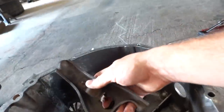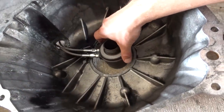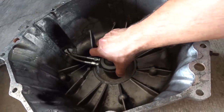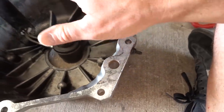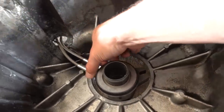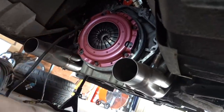In our old style we had the slave cylinder pushing on this, which would pull our pressure plate back. This is the new setup we're going with — basically a new slave cylinder, it's going to be a push type, it will push our pressure plate. It's just a different, more modern way to do it. We're going to start putting all this stuff in now. We had to chop a bunch of stuff — we were supposed to unscrew it but it was stuck really good, so we chopped it so it would all fit in there. Burke's here helping.